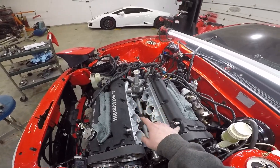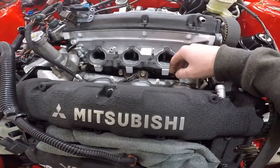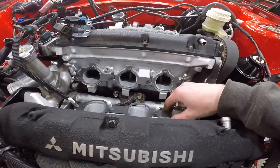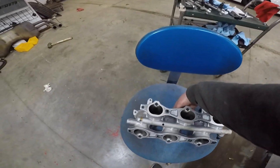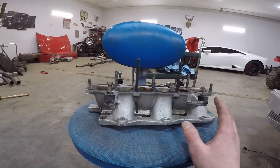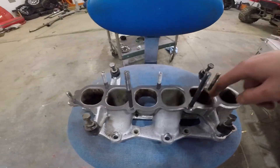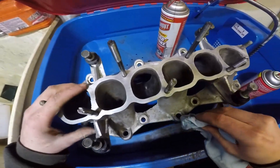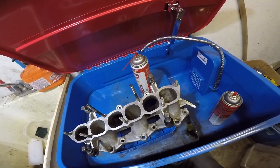We'll hook up this intake runner and then I can put the injectors on which are already on the fuel rail — then all I gotta do is plug them in. Just realized the camera was off, I was talking to nobody. Before I put these on, I went with nail polish remover acetone and cleaned all these surfaces under this gasket so it has a nice mating surface, and I also did the same thing to this. This is not fun to do because of all these little things — these little plastic pieces will fall off and you pretty much gotta take this off to get them out because they're plastic and you can't use a magnet. So I glued them with super glue. I'm gonna take some carb cleaner and clean these runners out. Make sure you clean these out real good — these little holes, this is where your injectors go. If you got any crud up in there your o-ring won't seal right, you'll have a fuel leak and you'll have to take this all back apart.